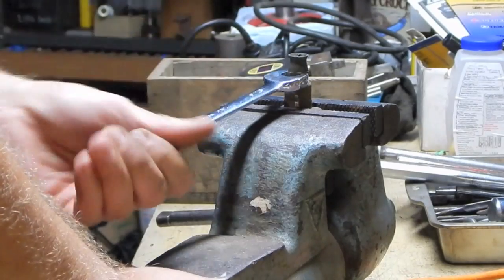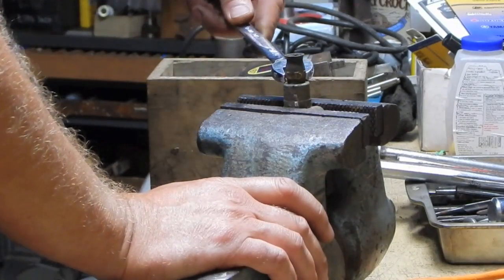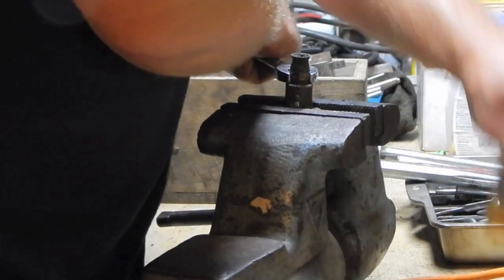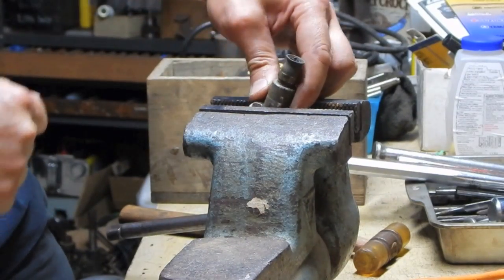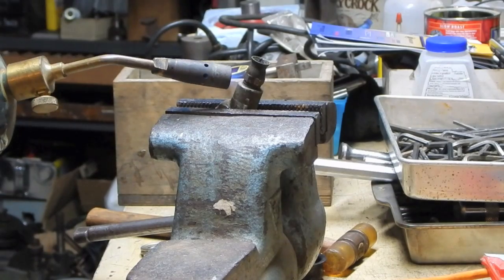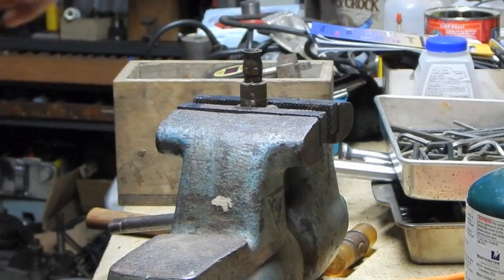Wow. That just, the wrench cammed out rather than, that's the soft brass fitting. Completely lost its shape. Let's see. Try it one more time. Nope, that wants to stay. I'm gonna have to use some heat. Just in case the components in there are spring loaded and they're gonna come popping out, I'm gonna wait till it cools off.